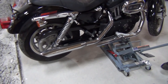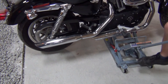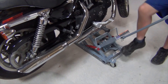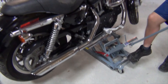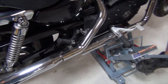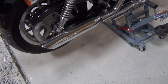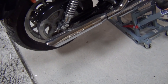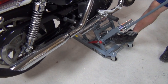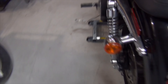We're going to jack it up to the third notch — here's the first notch. Make sure your safety latch lever goes down. Then lower it slowly, and as you see it levels out when you put it on the safety latches.